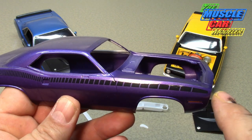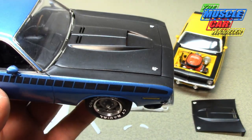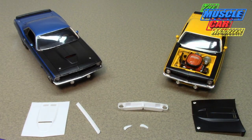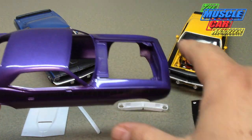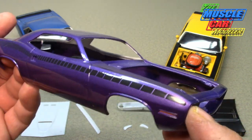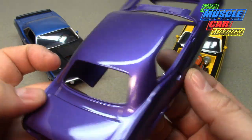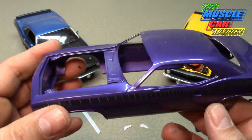Like I did on this one, I'm going to mask it all up and get really close, and where there's a little overspray I actually polish to get a sharp, crisp edge. I will show you how I'm going to do that. The trick is polishing, but since I'm using real automotive clear coat it's easy to polish the semi-gloss right off of it, so I'll mask and paint this area.